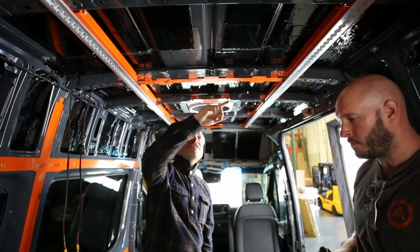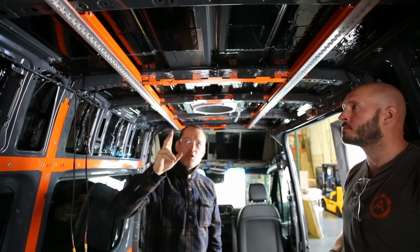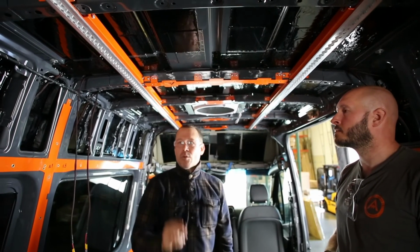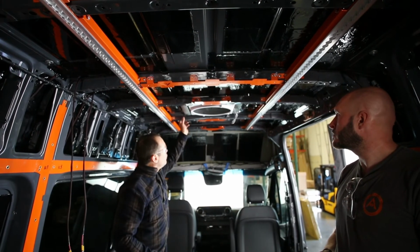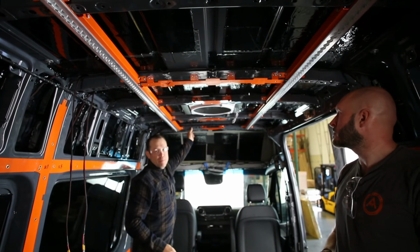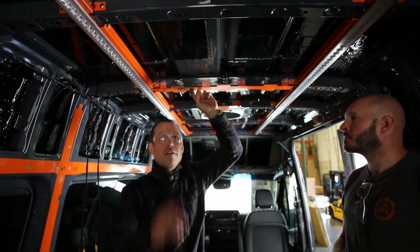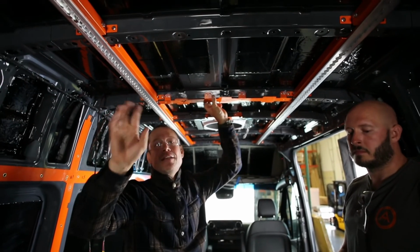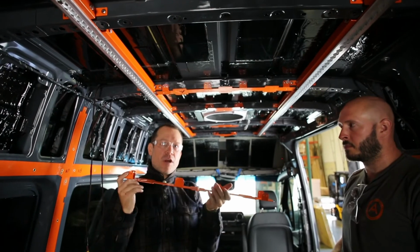All right, when you're finished with this guy, we're going to set the second one in the back. With the 170, it has 2; 144 only has 1. So we're going to go back, and if you count, this is the first rib. We're at 1, 2, 3, 4 is the 0 line, 5, 6, 7 is the next rib that you're going to put this cross piece on.